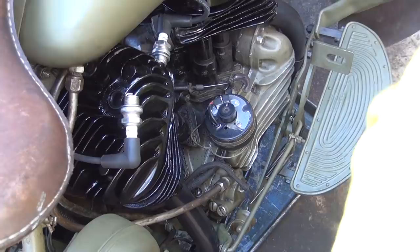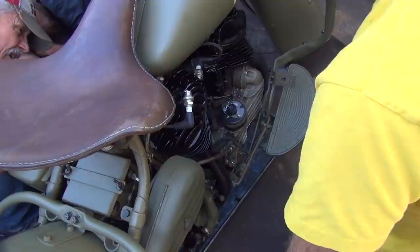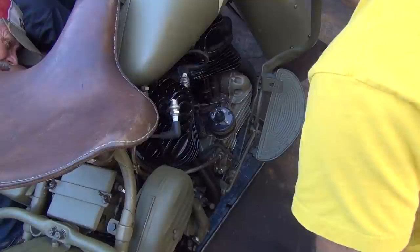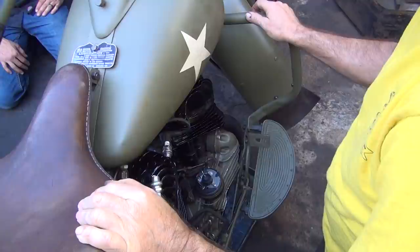Okay, make sure your eyeballs aren't over that hole right now. Turn the ignition on. Okay, spark's about right here. Yep, it did. Keep coming around. Okay, somewhere in the next minute or so it should spark. There goes the mark. All the way to the front of the hole, it's not moving. There, it's gone. Almost gone. It's gone. It's fired. So where's it at now? It's gone now. At least it was in the hole all the way forward. Now it's past the hole.